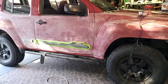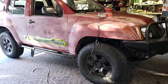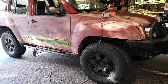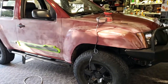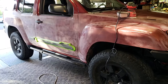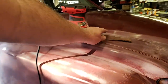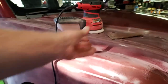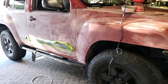So I'm getting started on the painting. What I'm going to do is use this stuff called Monsta liner — it's kind of a truck bed liner. I've seen it on a couple other vehicles and it turned out pretty good. It's not super bumpy, but it's still got enough bump to give it some texture. The first step really is just prep. I've used an orbital sander with about a 120 or 180 grit — I made fast work out of getting it roughed up. Otherwise they give you something like a hard Brillo pad type of stuff, and that's what you scuff. The whole idea is just to get it all scuffed and then wipe it down with the chemical.